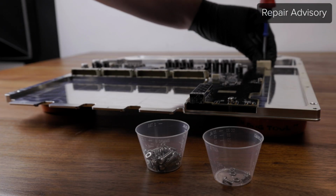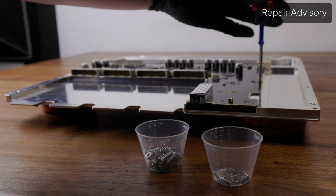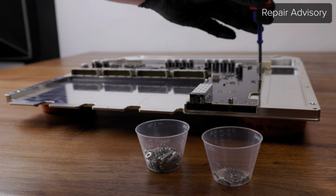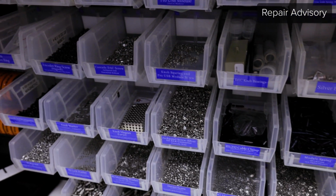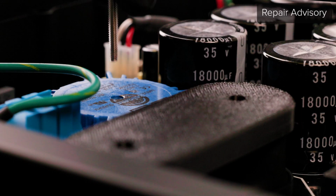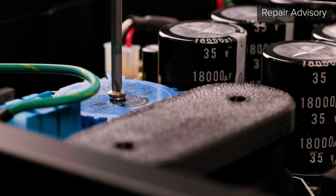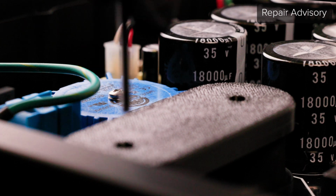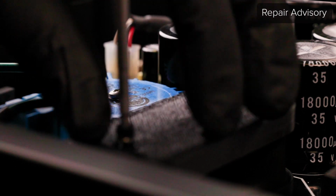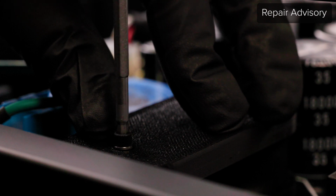It is important to keep track of all hardware throughout the build process to prevent any loose hardware from getting left inside the unit. Also, keep in mind that there is a variety of hardware used in each product. Some products use soft nylon screws to prevent unwanted electrical connections. These screws are delicate and can cross-thread very easily. Other products have crucial heat-sensitive devices. If over-tightened, they can crack and shorten the life of the product. Pay careful attention to what type of hardware is being used and how it is being used when disassembling your product.